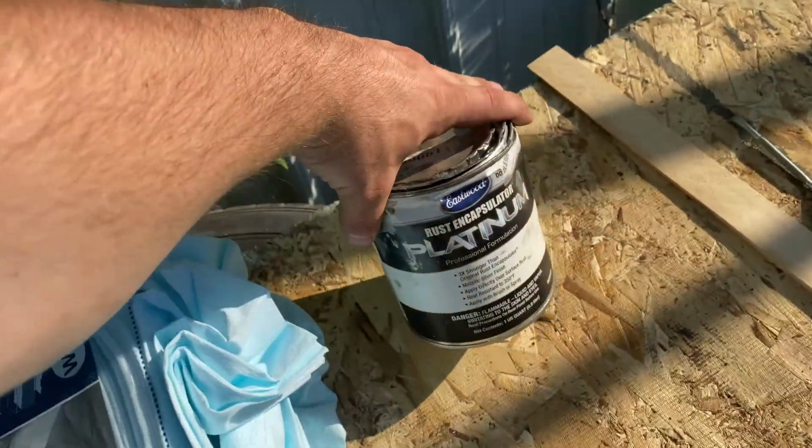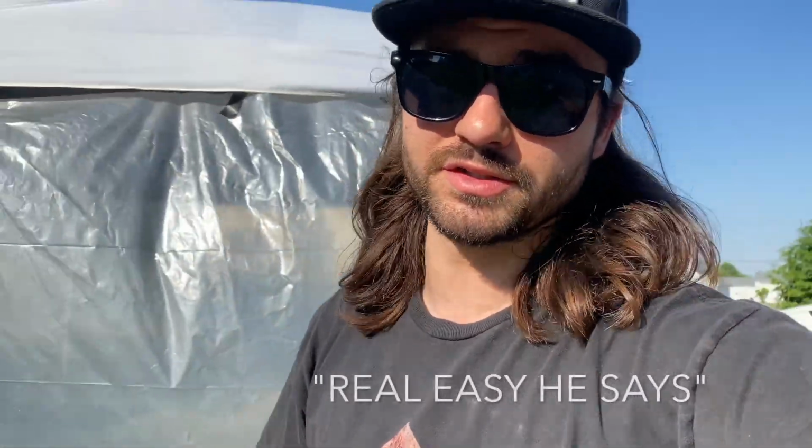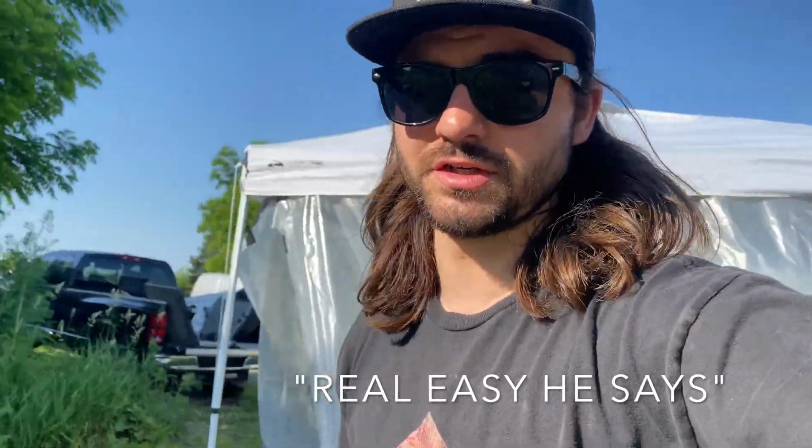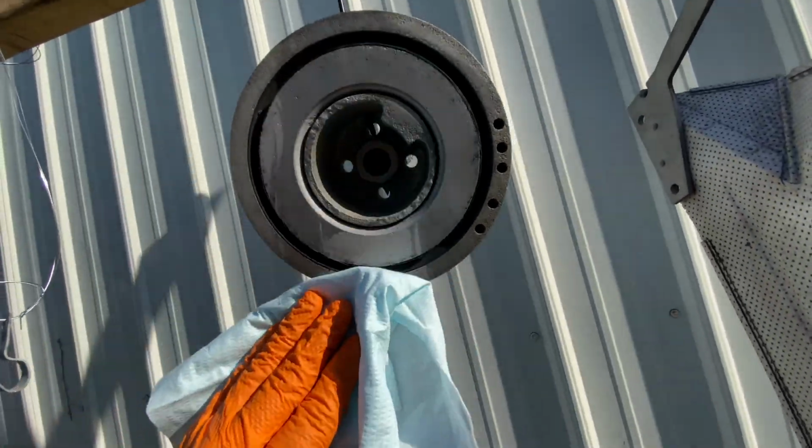And so this stuff, I'm just gonna brush on. I'm gonna go get some gloves and then brush it on, because they're not like super fancy parts, you know, they're not super smooth. But the ones that are, we can sand real easy and make it smooth with 360 or 400 and get it ready for the top coat. But we gotta wait 48 hours for top coat. Go with the lint-free towel, wipe down the surface.